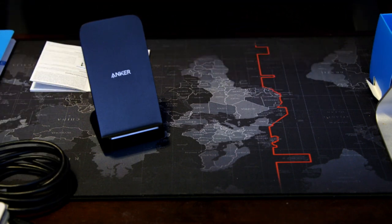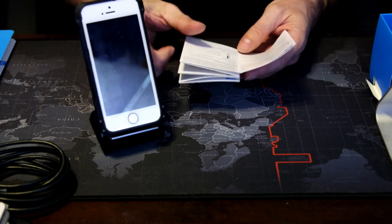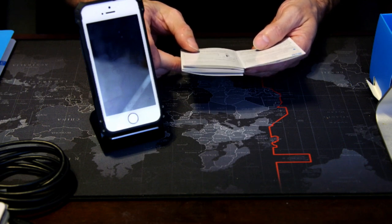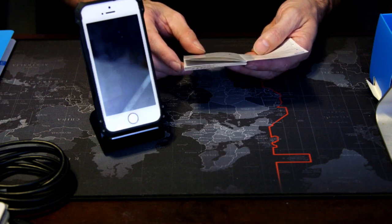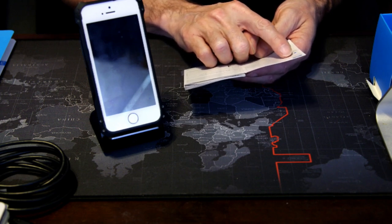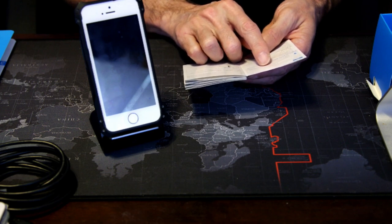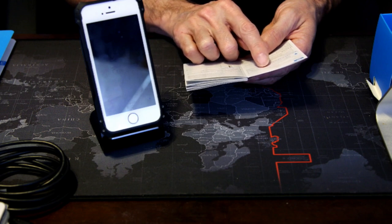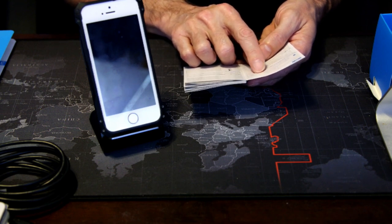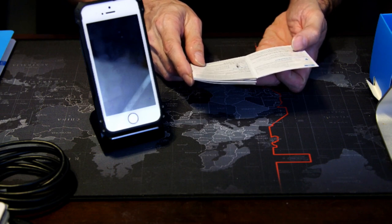From what I understand, it has a chip inside to prevent overheating, which I like — it may also help prevent battery degradation. As for the blue indicator light: solid blue for three seconds then off means connected to power; solid blue means it's actively charging the device; and flashing blue is important — it means metal or abnormal temperature detected, or an incompatible charger or cable is being used. So if it flashes blue right away, you may have an incompatible charger.